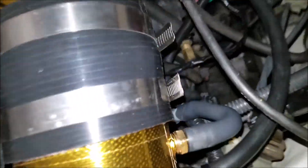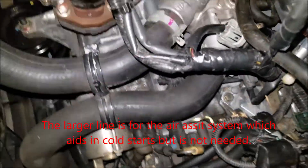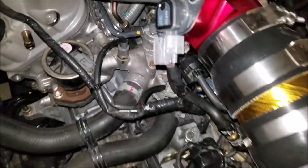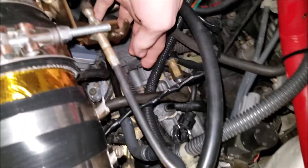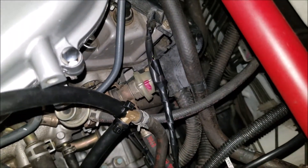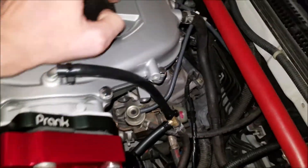I just got it heat wrapped to keep the intake temps down a little bit. And I have this hose barb which is in there for this unit — I'm not entirely sure what that is. And then I have my intake temp sensor which is stuck out on the bottom with an extended harness. That goes to the stock right there — there's no port for it on the side of the magnesium manifold like there is on aluminum.